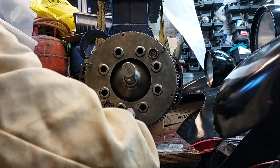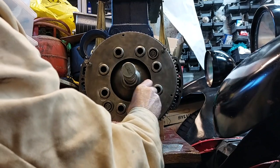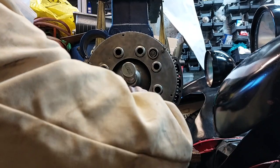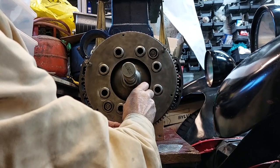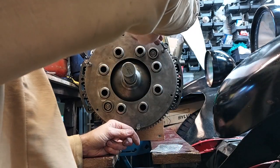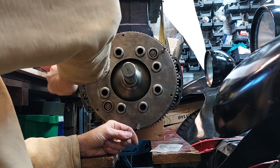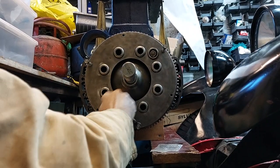The assembly bolts with the nuts, they work really well. And as you'll see, I put the clutch alignment tool in, but just the side forces of the plate when you bolted it up kept moving it, and every time I took it out, it wasn't quite in line. So what I'd done was just release the pressure slightly and go the good old-fashioned route of putting a brass bar down there and moving it around by eye and then gently tightening it back up again.